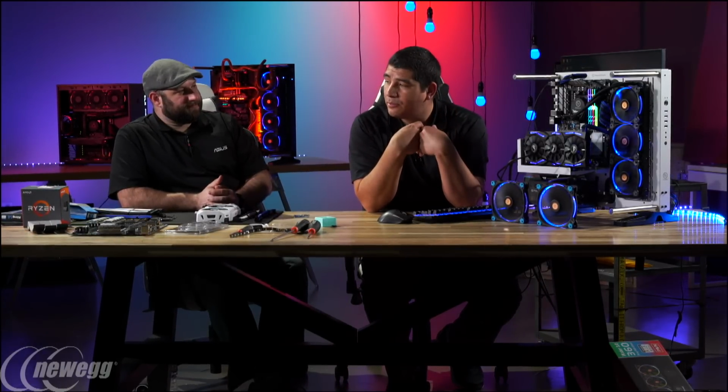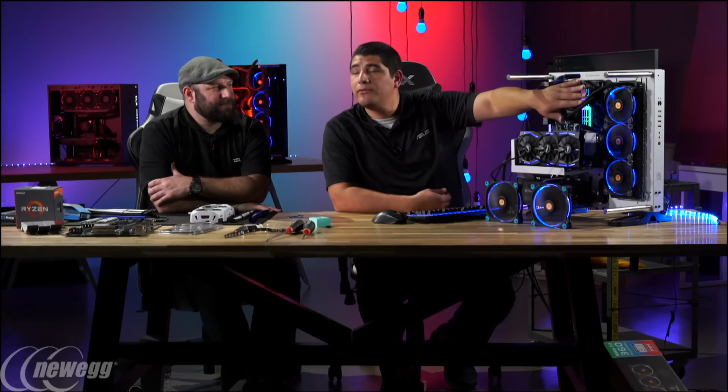Correct, 2 DIMMs. And that's going to pretty much be capable on great boards. Now, there may be other boards on the market that might not be able to hit those same frequencies because there is some requirement on the hardware design and the UEFI, but the Ryzen series CPU is not limited in this regard. So we can hit pretty aggressive DDR4 frequencies up to that 3200 megahertz. Right. So that's going to be for 4 gig DIMMs, 8 gig DIMMs, and even 16 gig DIMMs, if you're talking about 2 DIMM configurations, right? Once you go to 4 DIMMs though, you will have a lower limit.